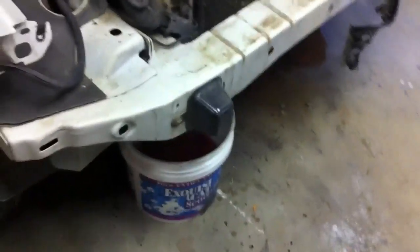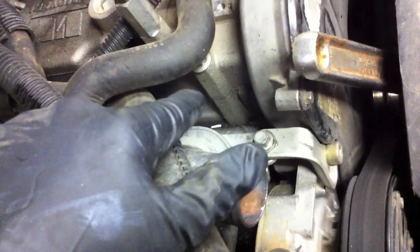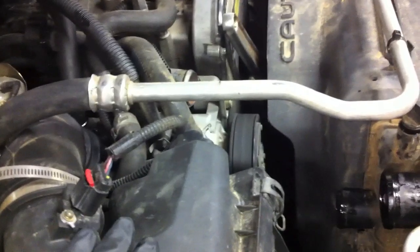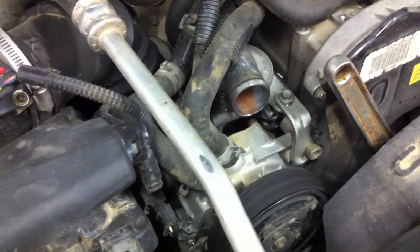The radiator is still draining. While that's going I'm going to get the air box out of the way. On this Jeep we're also going to be doing a thermostat, which is right here in this housing — it bolts to the side of the head with three bolts. It's pretty difficult to get to; you have to pull off all these little ancillary heater hoses and take the air box off to get in with a 10mm. If I wasn't doing the thermostat housing I'd leave it in, but we're also doing a water pump and a viscous heater, so I'll just pull the air box off — it'll make things easier.